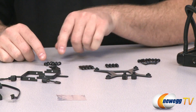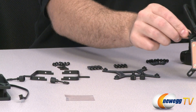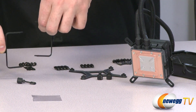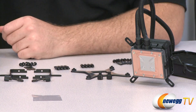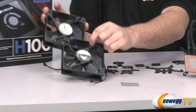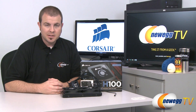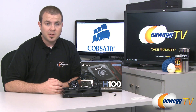We also have bolts for mounting the radiator to your case, as well as washers. For the AMD cooling solution, you simply remove the brackets from the sides — they're bolted on with Phillips head screws — attach those, and the little hooks with thumb screws will clip onto your AM2, AM3, or AM3+ bracket. That does it for our accessories and wraps up this unboxing and overview of the Corsair Hydro Series H100 Extreme Performance Liquid CPU Cooler. I'm Paul with Newegg TV — if you enjoyed today's video, head over to our Newegg YouTube channel and subscribe. Thank you for watching!